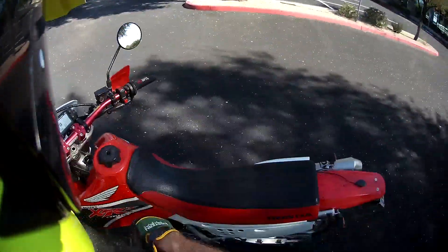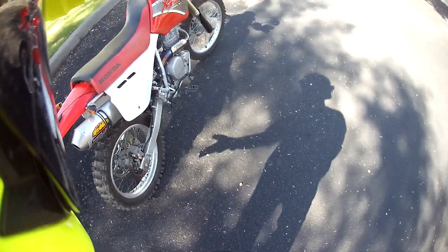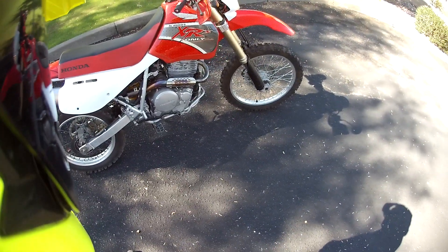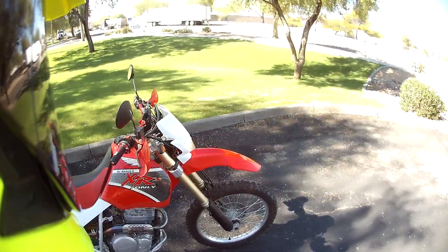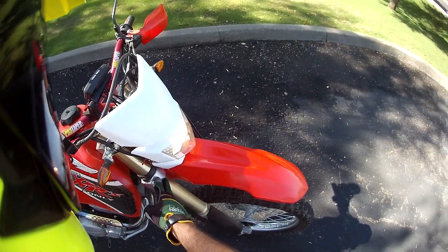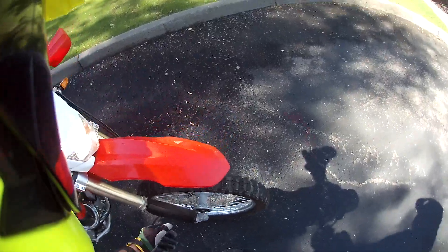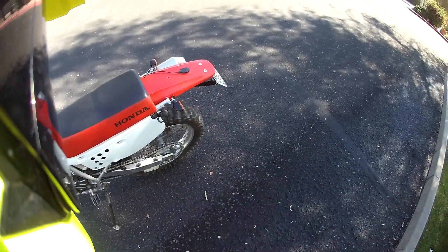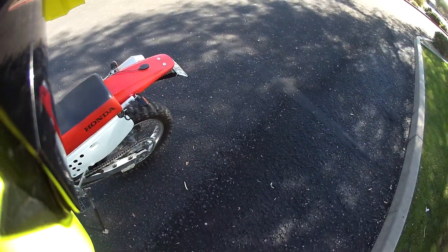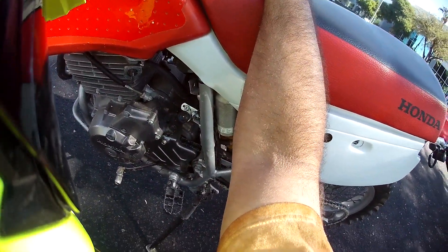This is the new scoot. Like I said, a lot of these parts are going on my bike. This is a 2007 Honda XR650L — it's full of mods. It's got the FMF PowerCore 4, and I got the Quiet Insert coming. It's got the power bomb right there, the lowering link, which I like. It's got the fork clamps from RWC and the CRF450 front forks, the different housing, small lights, the 41 Pumper Mikuni, new chain, new sprockets. The motor sounds nice and it shifted fine.